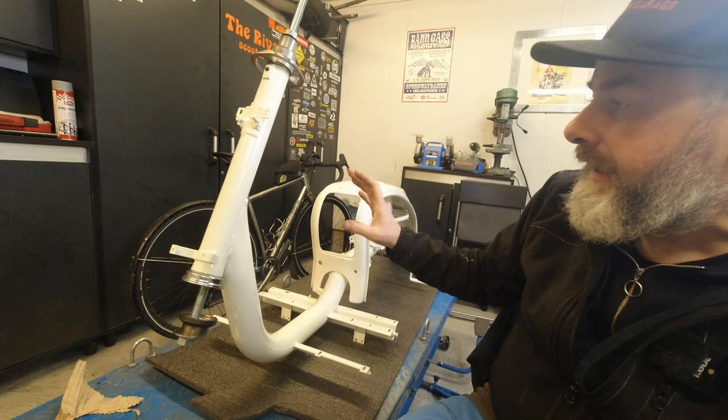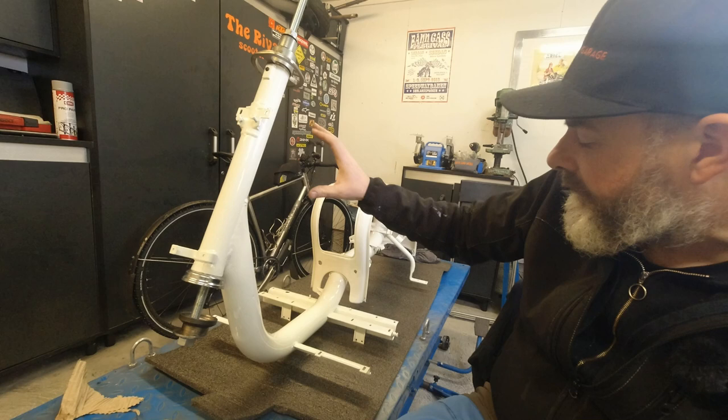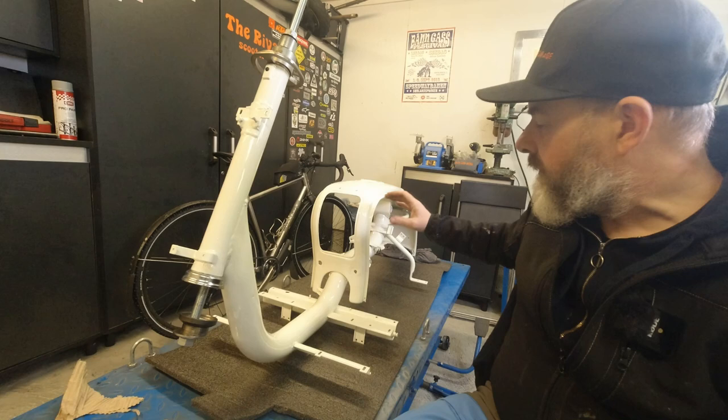So the plan today is basically I want to get this up on one wheel and the stand. Crown race first, then I'm going to fit the stand and splash plate - I've actually never fit a splash plate before, so that should be interesting. Get the stand on, then fit the fork, tighten down the fork at the top, then it'll stand by itself. And then I'm going to do some smaller jobs.